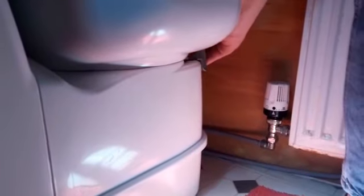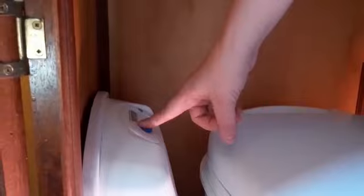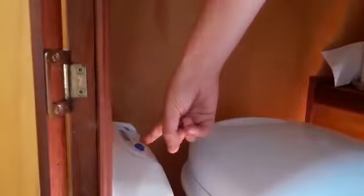The shower and toilet are just behind this door. When using the toilet, it's a cassette affair. There's a small handle just under here — slide it backwards to open the hatch inside the toilet, go about your business, and then on this side there's a little blue button you press for a rinse. There's also a red light that will come on if the cassette is full. Once rinsed, go back under here, slide it back across, and it's closed. The shower is just behind as well.